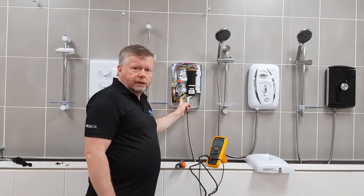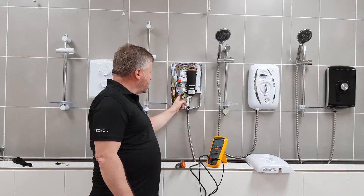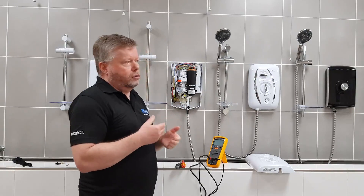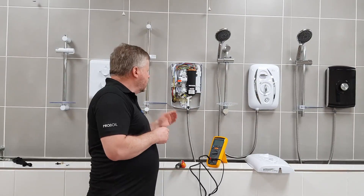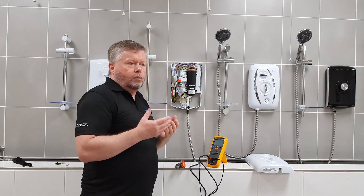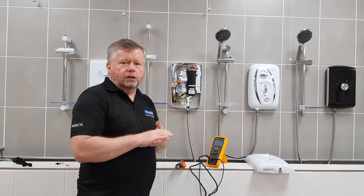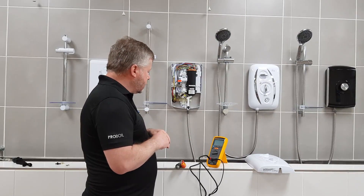The component we're looking at today is the solenoid itself. This comes complete with the solenoid body and the solenoid coil, which is brown in color — could be black or green but more than likely brown. It has two connectors on it to provide it with power. It's just a coil of wire, and what can happen is the coil can break, giving no continuity, so no water flows.